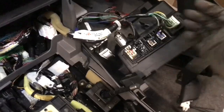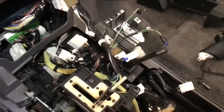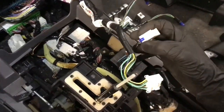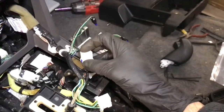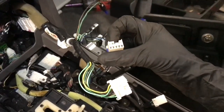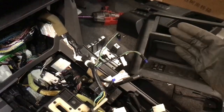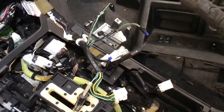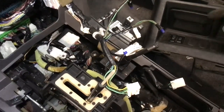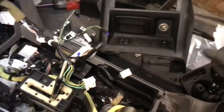With the shifter in neutral, there's enough room to flip that whole thing over and start unplugging the wire harnesses. You might notice an extra wire harness plugged into a switch blank on the panel — that's totally normal. This went to the power antenna on foreign market vehicles, where you could raise and lower the radio antenna from inside the cabin. That was not on US Monteros, and no, you can't get one of those switches from overseas and have it work — there's also a relay missing in US vehicles. So don't fret about that on your wiring harness.